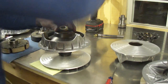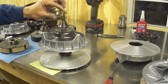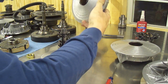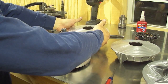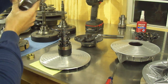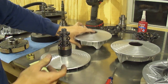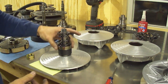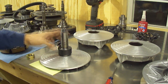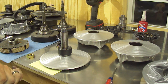Now we take it back apart — starting all over from the beginning. You take off your nut, and the outer half of your clutch will come off. You can set the clutch upside down and the fixed plate will fall out, holding all of the sliders. You have your outer movable sheave, your spring, your spring hat, and your one-way bearing. And that's how it all goes together.